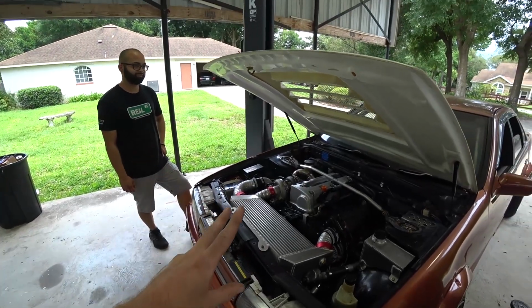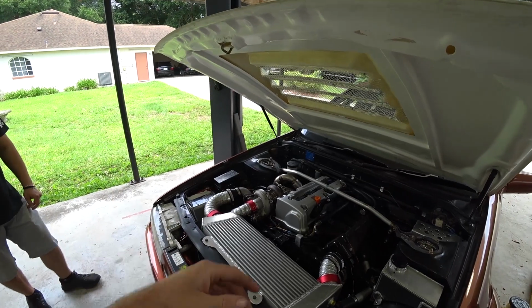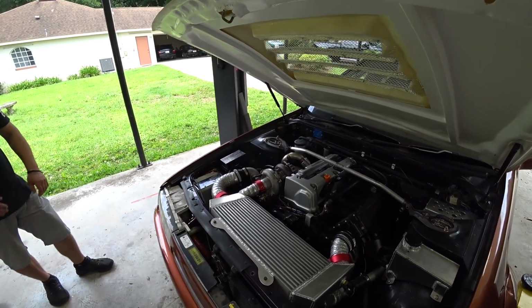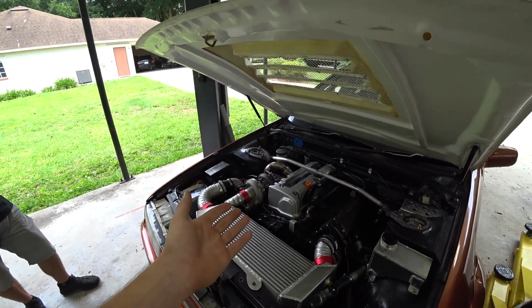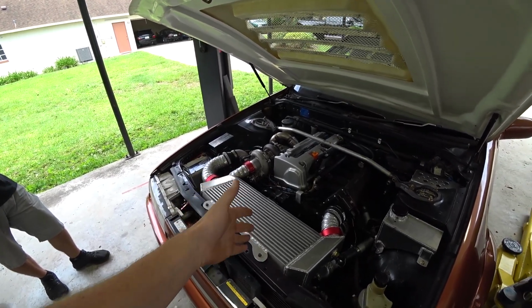Anyway, we've got 2 issues, right? We're getting a crank signal error. Once we get to that 5,200 RPM, it's triggering an error, which presumably is our problem. Seems like it might be the sensor. In a lot of cases it is a sensor, so we're gonna try to get a new sensor for it.